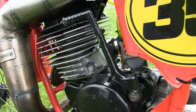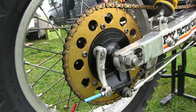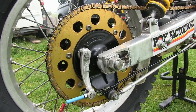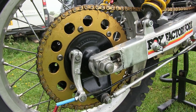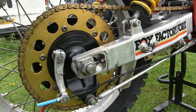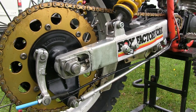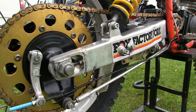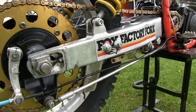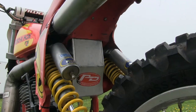Although this bike's rear swingarm looks for all the world like it's custom made, it's actually a swingarm taken from a CRF450 Honda, which has been modified to take a pair of twin shocks at the rear rather than its original mono shock unit. It's perfectly suited for this bike because this box section alloy is super strong and has virtually no flex, which is great for feedback to the rider when used on a bumpy racetrack.